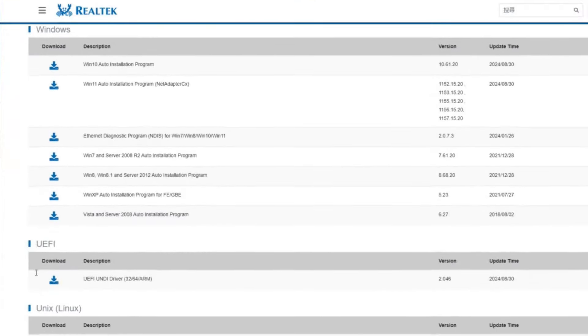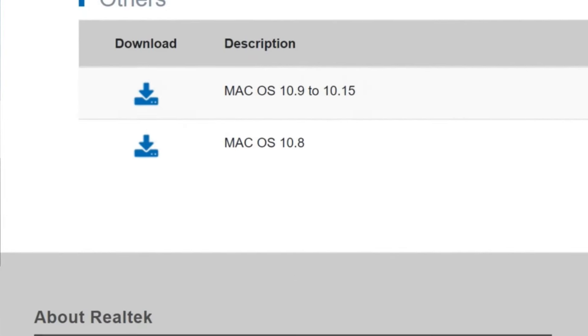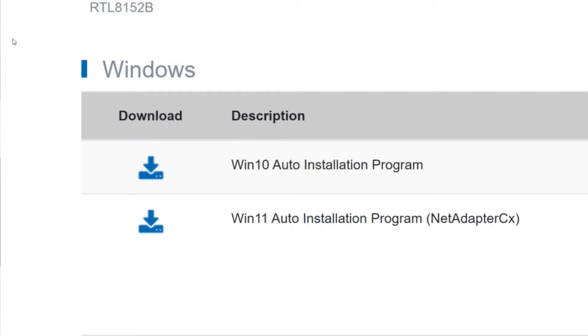We did need to download drivers for the Windows system. On the NAS side, I could not find a NAS that would recognize it — it wouldn't work with QNAP systems even though QNAP have their own 5G adapter, because those use a different Realtek controller. I haven't found a driver for this RTL8157 on other NAS operating systems. The only one I could get close to working was Unraid. So at the moment, if you're thinking of adding this to your NAS, it probably won't work on the NAS side — but on Windows, Mac, or Linux client side, it's fully functional with available drivers.